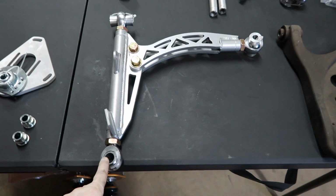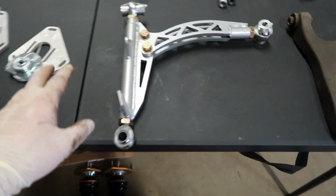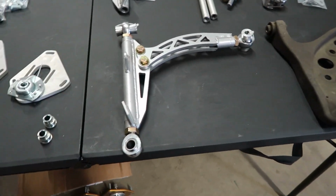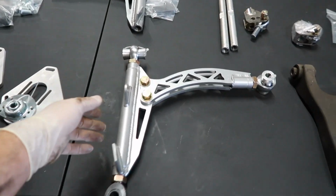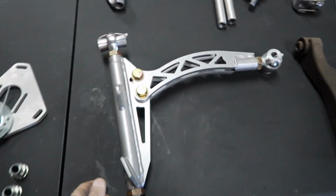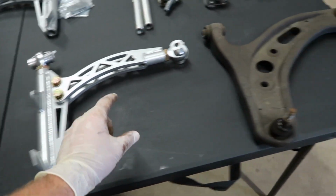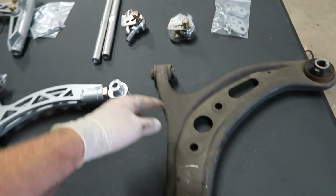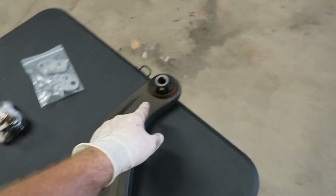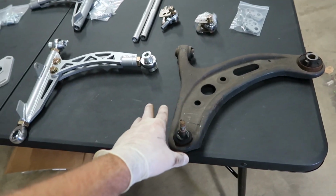Alright, so I assembled the control arms. I put all the Heim joints in their spots. So now this is the part when it starts to get a little tricky. This is when I'm kind of out of my realm of knowing really what to do. So basically what I'm going to do is get the base measurements off of this. I'll do from here to here, here to here, and here to here, basically just the triangle, and I'll get all the measurements for that.